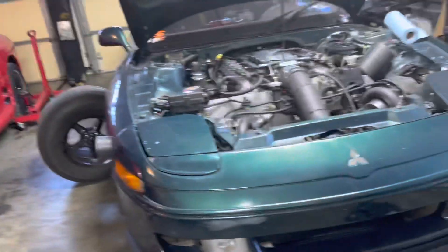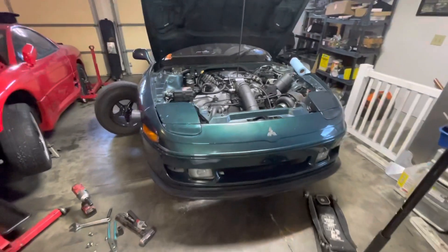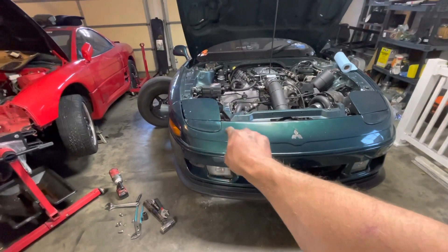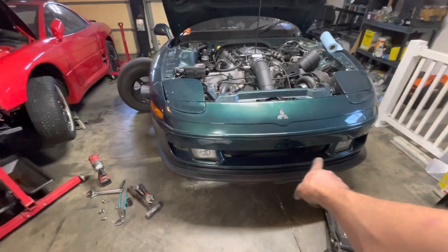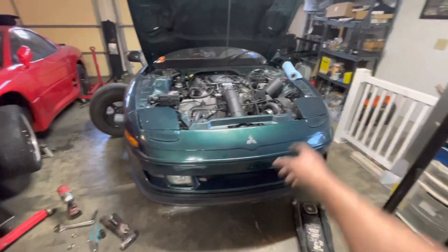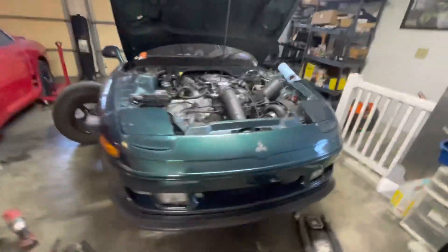Always improving. Hands dirty, been in and out of the car for a while. So a few things — pop-up headlights again. This saves like 15–20 pounds, which was more important when it was rear-wheel drive and doing no prep, because going with the pop-ups out, putting in the stock clear snake eyes with LEDs behind there, it worked basically as good as normal low beam, especially combined with LED replacement bulbs and the fog lights. But I just really didn't like how the clear lights looked, so that's the main reason I put these back in. Now I actually have high beam too, which should help — low beam I really doubt it's going to do a whole lot more, but there you go.